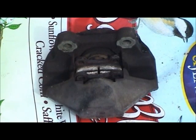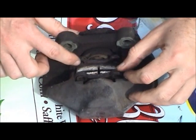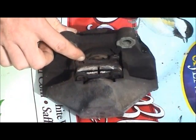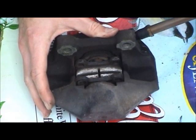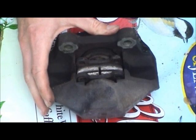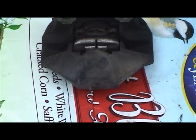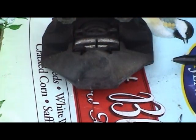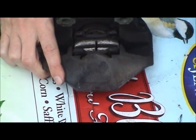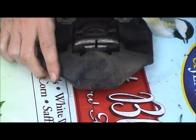I had a little change of heart - I'm going to use these older burned-up brake pads instead. They'll give me just enough space to get the pistons started out of their bores. It looks like I might have to ramp up the pressure a little bit - it's shooting out some brake fluid. Now I've got it up to around 110 pounds. This is a typical problem with older calipers because they tend to have some corrosion inside and they're a little bit tricky to get apart.